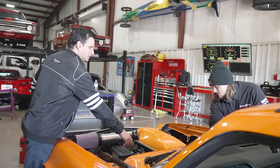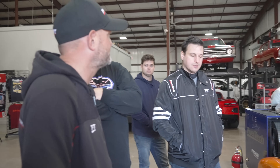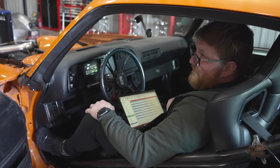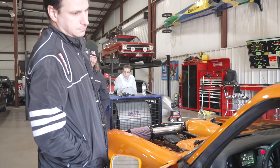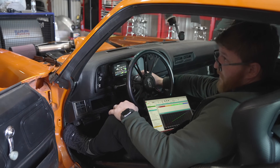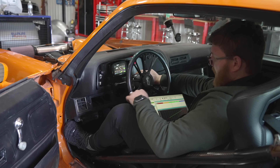What is the heat sink on it? An IGN-1A would have died there. That's how we killed one in the dragster — testing it without the plugs. If it can't complete the circuit, it fires inside and burns it up. It's in wasted spark right now. It's a TPS-based tune anyway, but it does have MAP.